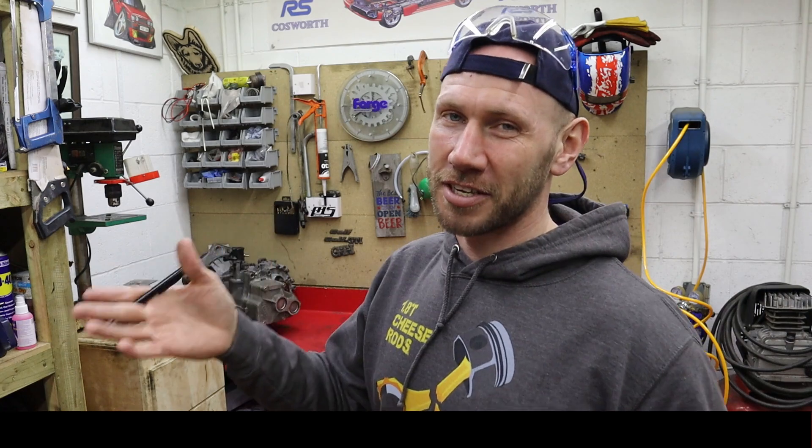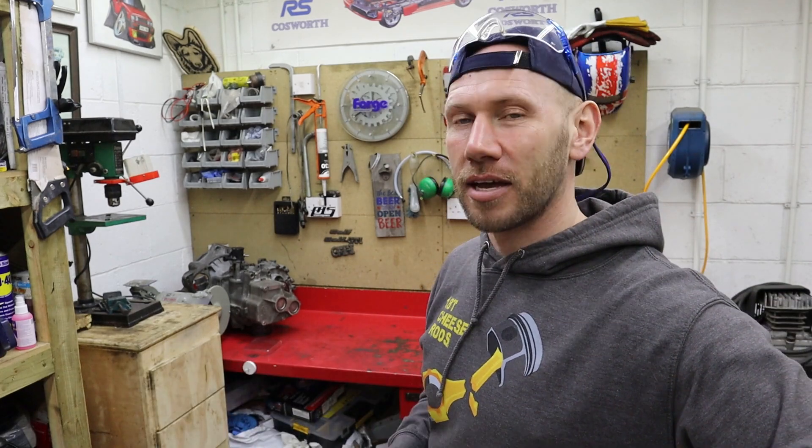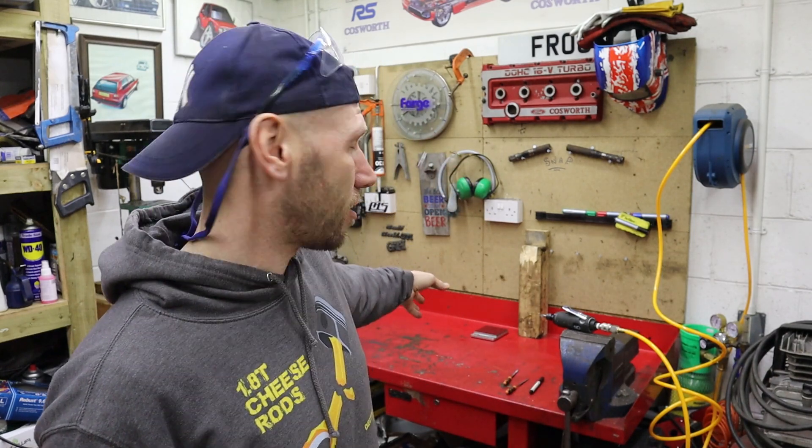I mean, as a lesson in engineering science it's quite the failure, but in terms of knocking up a little DIY jig and getting all the pistons and pins to within 0.1 of a gram — great. Little ends 0.1 of a gram — great. Big ends probably a little bit over, but I can live with that. It's without a doubt more balanced than what it was. I could improve on this — the jig could be better, I could have used better scales, and in all honesty I probably could have been a better YouTuber. But let's not let that stop making a video. I did achieve what I set out to do; the accuracy wasn't as good as I'd like on the big ends, but the rest of it's all right and it's certainly all better than what it was from factory. So I'm pretty happy. Thanks for watching, don't forget to hit subscribe, and we'll see you in the next one.